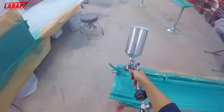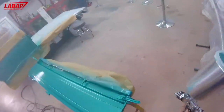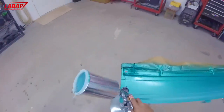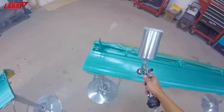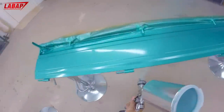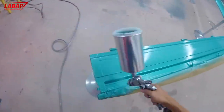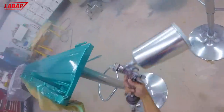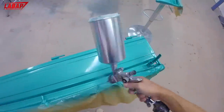Take your time and make sure it's all covered before you move on — it's not a race. This is the last point before clear coat where you can really screw up if you're in a rush. If you don't have enough base coat and the clear coat is already on, you basically have to re-sand, re-base, and re-clear it. Lighting is important — make sure you have a lot of fluorescent lights so you can see any spots you might have missed.